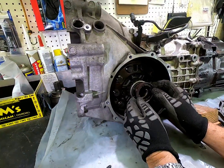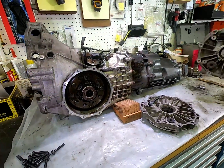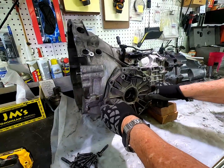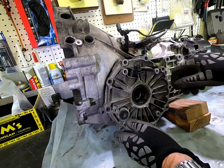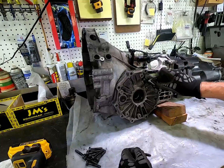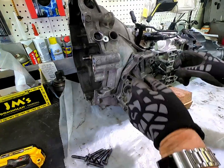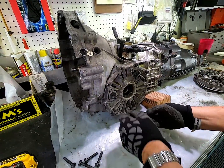As you can tell there are two little tabs in it — they fit right here. You line it up, press it on, then put your side cover on and you have a speed sensor. When you do this, the cover needs to be lined up at an angle. If you try to put it on straight these bolts will not line up. Start a couple of bolts by hand — that way you're assuring the side cover is going on properly.